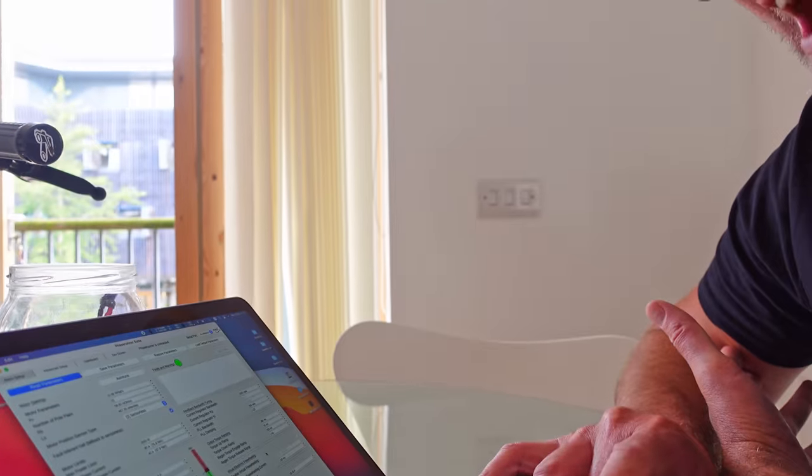we haven't got any electronic freewheeling set on, because this motor and this setup is not ideal. If you're going to think about doing this, it's not ideal at all, because you've got a motor that has no Hall sensors and you're using a controller that is running in sensorless mode. So it means your startup is going to be super rough, and you might be able to make that a bit better, but you're never going to cure it right at the beginning. Can it be improved somewhat? Yeah, it can, but you'll be sitting here all day.